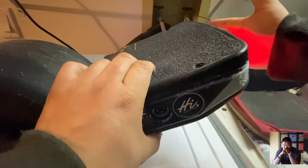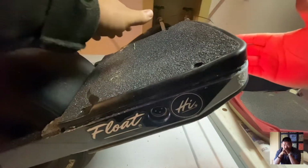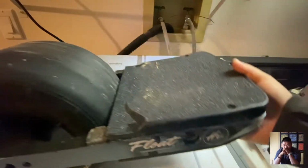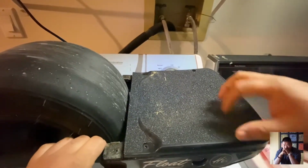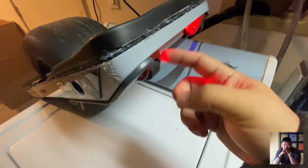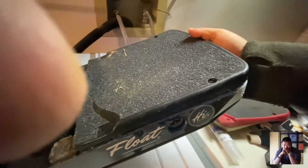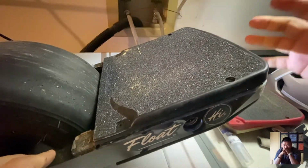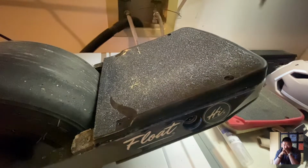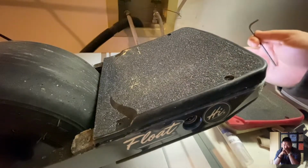All right, so I got it put back together now, and you can see when I activate on that side, the light brightens, so it went on, and also on the other side. One thing to keep in mind is when you're tightening, especially these two screws here and the ones holding your front up there. Right now I've got Fang Minis on there. When you're tightening those screws, especially these four, you need to be really careful. Before you even jump on the board, tighten these screws down and watch it in the app, and not only in the app, but watch your lights.